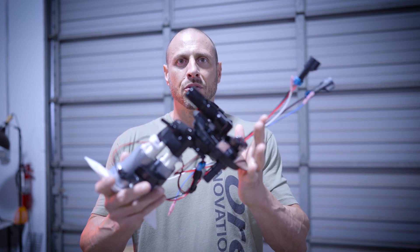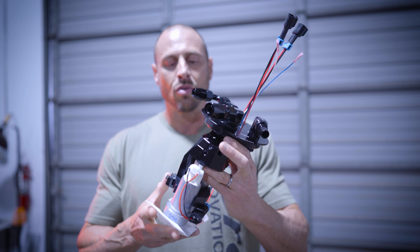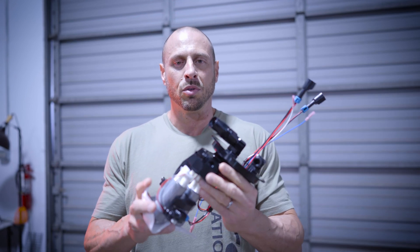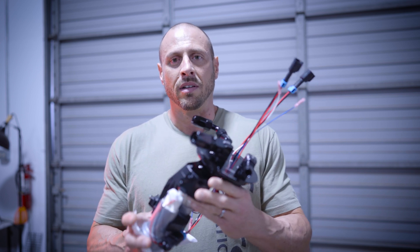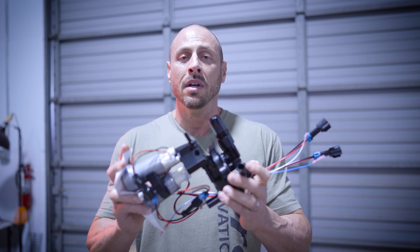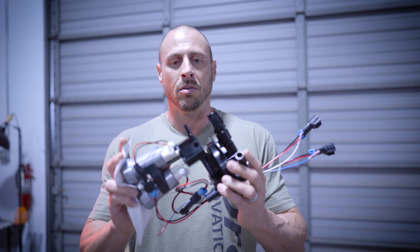This is the pump module here. This is a two-pump assembly, and we also have a three-pump assembly as well. This is not a drop-in to the tank and be done type of thing — this is part of a comprehensive fuel system upgrade. It requires a feed line, a return line, external filtration, external regulator, and we're using this to feed the high pressure fuel pump. You can also use it to feed port injection and nitrous on top of it, since it's way more than what the high pressure pump can handle by itself.